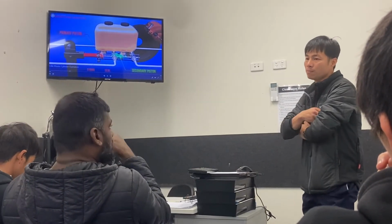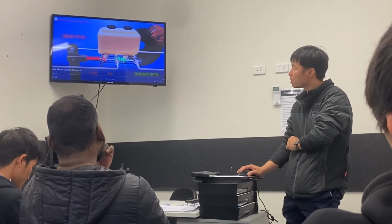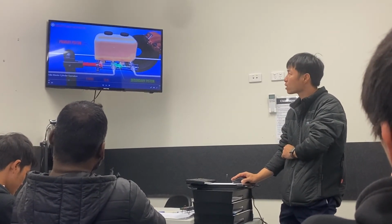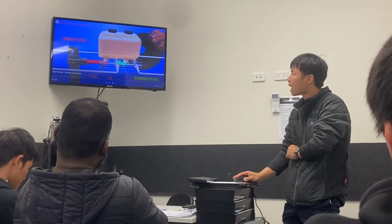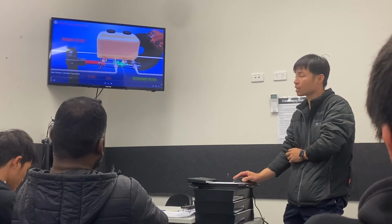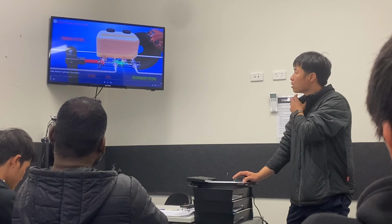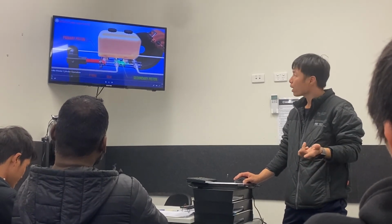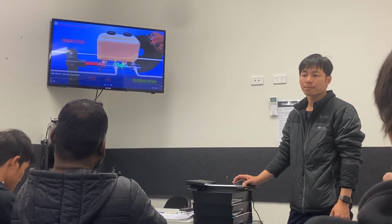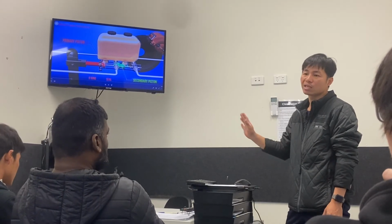But the tank is separate. Normally, it's supposed to have another separate unit here in the middle. So if this one fails, half our reservoir will be gone, but we still have the other half for the secondary one. Alright? So, question, why does the primary have one push rod but the secondary doesn't have any? Simple. It's only two chambers. Because it doesn't need to push anything.